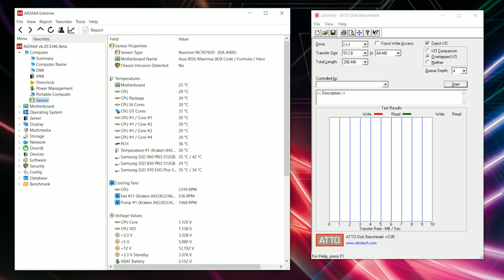As you saw from the first run, when we ran the NVMe without the heatsink, we hit around 87 degrees. For reference, Samsung's data sheet shows the normal operating temperature at 0–70 degrees C, with throttling beginning around 79 degrees. That doesn't mean you'll necessarily notice throttling, but the controller will start to throttle around the 79–80 degree range, so ideally you want to be below that temperature when operating.